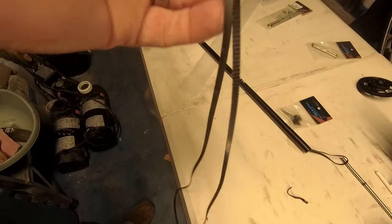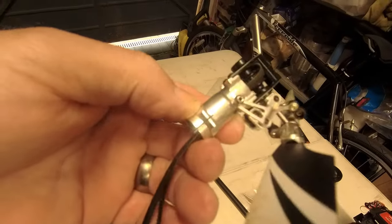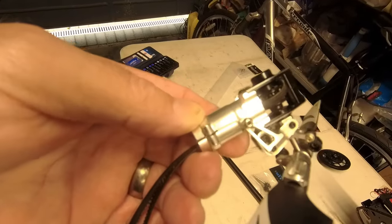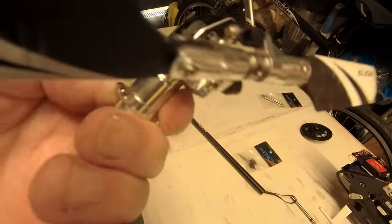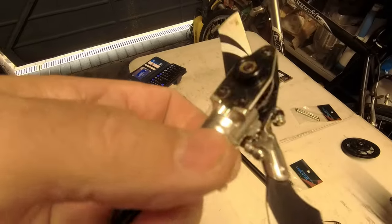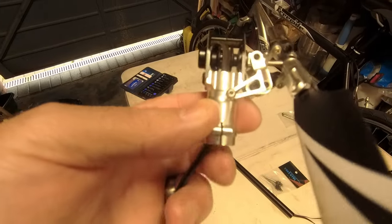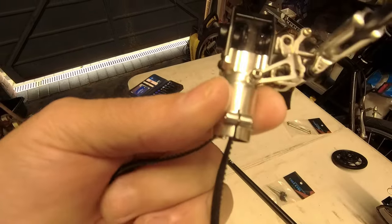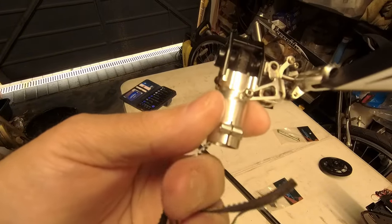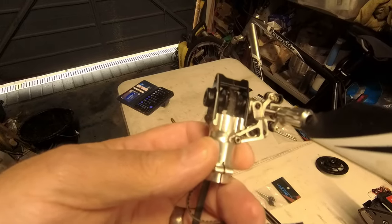The belt is still in the tail - it could have gone again, but for the sake of five or six quid I've got a new one. I've now got to take the blades off the blade holders and take that shaft out to replace it, because this one is slightly off-center. When you crash them it's not worth messing about - they're very thin and will cause a lot of vibration if they're bent.